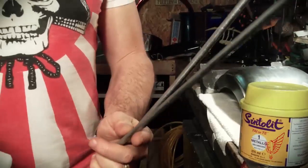So with my friend Polskyrage we have tried a few different solutions, from some metal putty to the very old school system of laying down the lead. But unfortunately all these materials got damaged during the heating process — the putty made bubbles and the lead actually melted away. So for me, no matter what you read on the forums, the only solution is to fill the holes with the welder and then smooth them with a grinder or sandpaper. That's what we did for this fender.